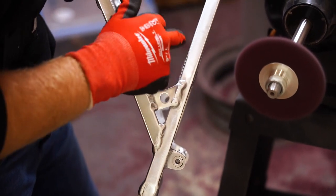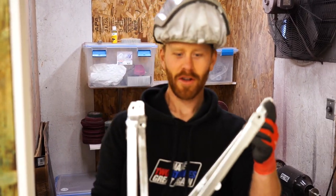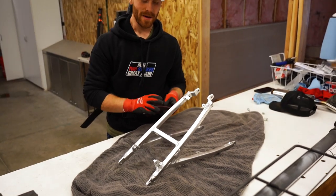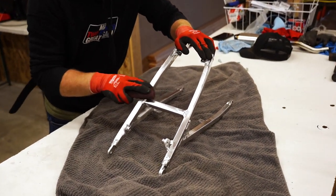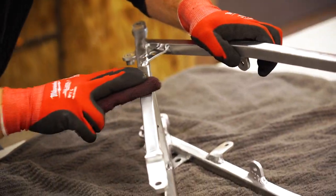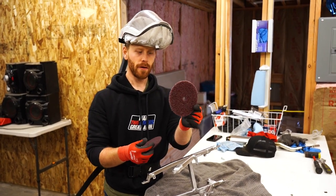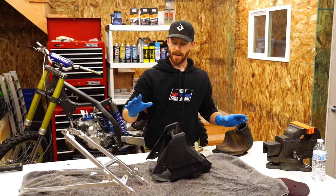The most important thing here is to go in the same direction that you were buffing before. In the tighter areas — like underneath, inside the bars, in the tighter corners — I'll be using a wheel on a die grinder. We're all done in the grinding room. The last thing, just to add a little extra sauce, is to take the finer wheel and go in the same direction I was buffing in. This gives it a much more consistent finished look. In review on the subframe: I used the rougher wheel to strip off the anodizing and blend in all the scrapes and scratches, then finished up with the finer wheel.